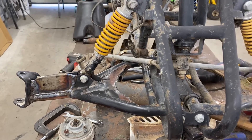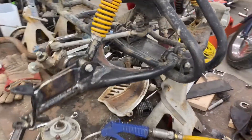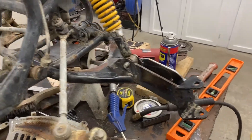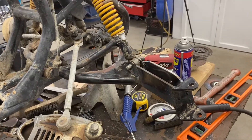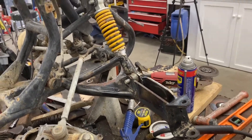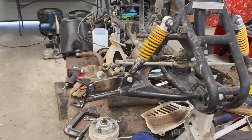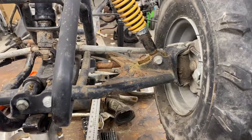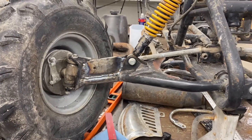So here's one lengthened control arm. Hoping it's going to give me the stance I want. The overall width of this will be just under four feet. I'm hoping with the shock location and that extension, it's going to make the ride a little softer and also give me more travel. I just mocked it back up with the old shocks — those are coming off, there'll be different ones going on. This is just the start of my modifications; then I'll start working on the chassis. Now I have the fun challenge of making this control arm the same as the other one.